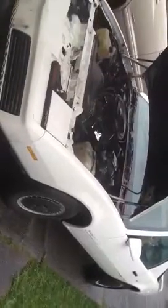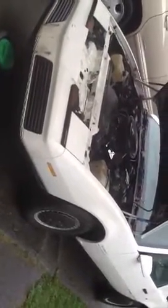I drove it and it seems to drive pretty good. It has a little bit of bucking — I don't know what that really is, but it's not bad. It seems to run pretty good, pretty stout. My initial timing went from 10 degrees up to 15 due to the total timing, and my total timing is what I really want at 36 degrees.